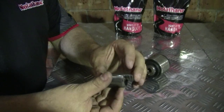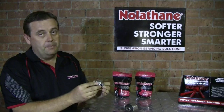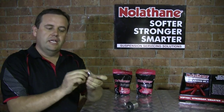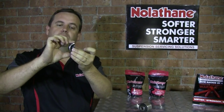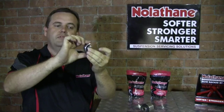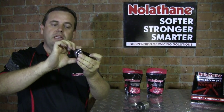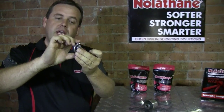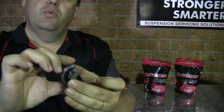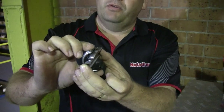As per other models that have this type of bushing or bearing inside the suspension system, if you jack up the suspension system and try to test it, it's already too late. You need to check it at its ride height. That panhard rod will be being hit consistently, trying to stop the car moving laterally down the road and keep it in line with the wheels. As soon as you jack it up, not only does the diff go down — so we're rolling — but it also pivots away. So it's working in two different directions, and it's already too late to check that when you've got it at droop.